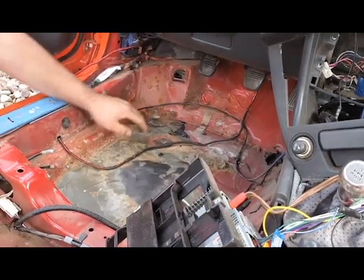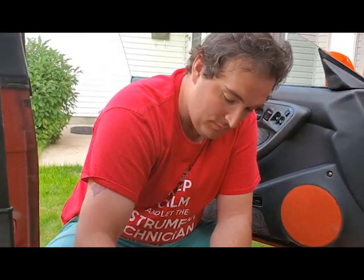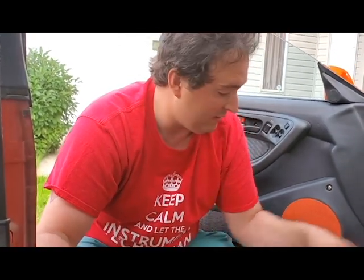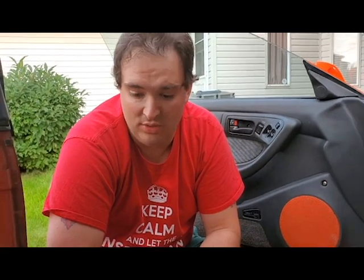As you can see, we've got some deflection here. It is skinned, so there are two sides to this. Up here everything's really good. One small patch up here we're going to make. To make this really more of a safe car, I really want to make sure whoever gets it gets a car that's in decent shape. Or if I'm gonna drive it over the winter, we'll figure that out. We're gonna get some steel over the next day or two, weld this panel up, and make a small patch up there.